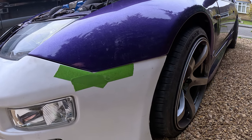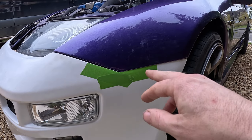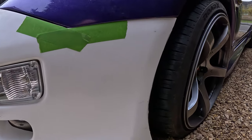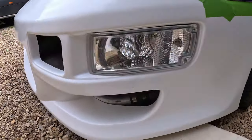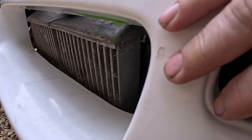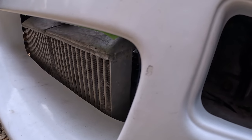And then touch up the bit around the other side, in the corner, the V bit around that side. And then it'll probably be doing some bodywork, like this for example. And then just going around and finding the imperfections like that, putting a bit of glaze in it and getting it all sanded smooth where we've done the imperfections, and then sanding the whole thing down with 500.